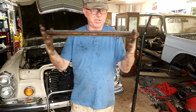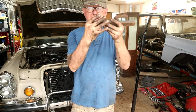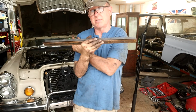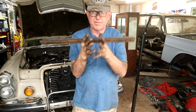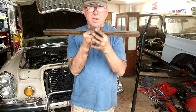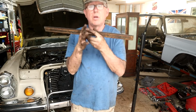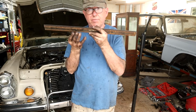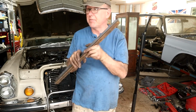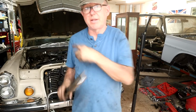And then the bridge is so I can bring my jack in and lift it up, just giving it a little bit of tension, but not so much it lifts it off of the axle stands under the body. So give it a little tension, raise the axle stands here and here, and then lower it, and essentially that's the engine isolated. Then we can pull the subframe down and leave the engine in place. That's the idea anyway. So let's put these in place and I'll show you. I'll get them fitted and then I'll bring the camera down.